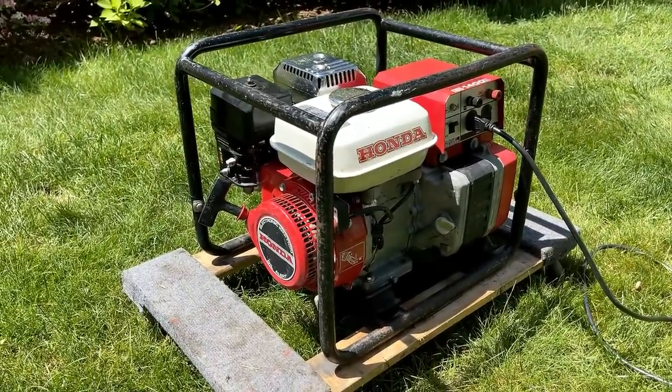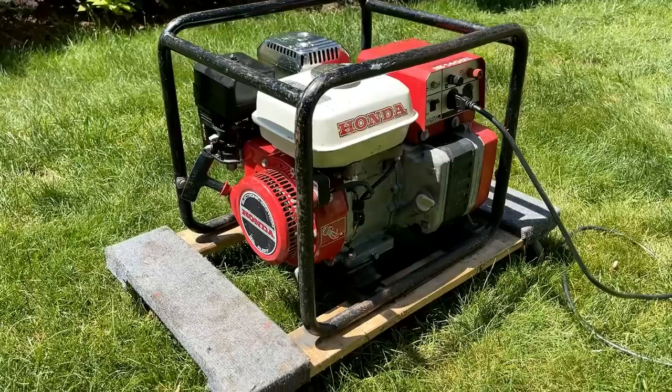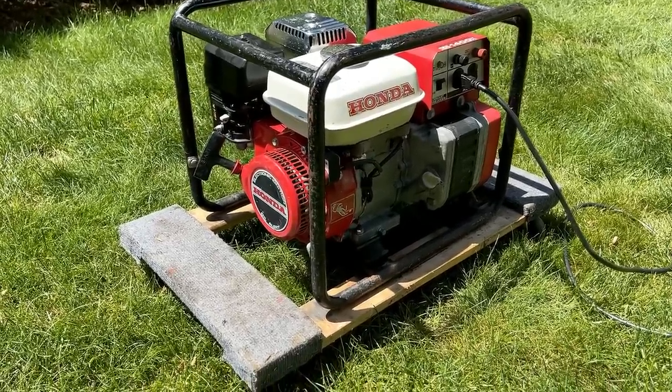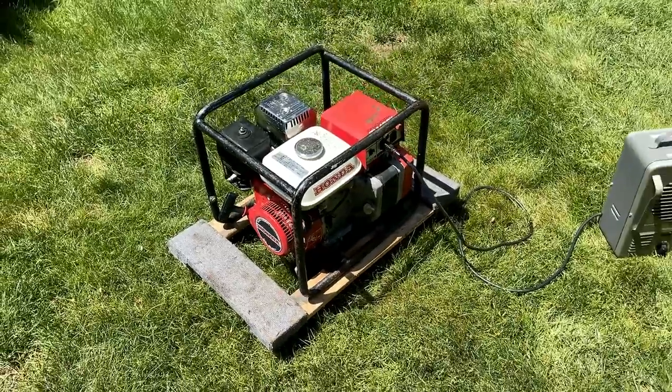It just needed that fuel inlet cleaned up and a new air filter that wasn't soaked in oil and a little bit of cleaning. So anyway, I hope this video helps someone.